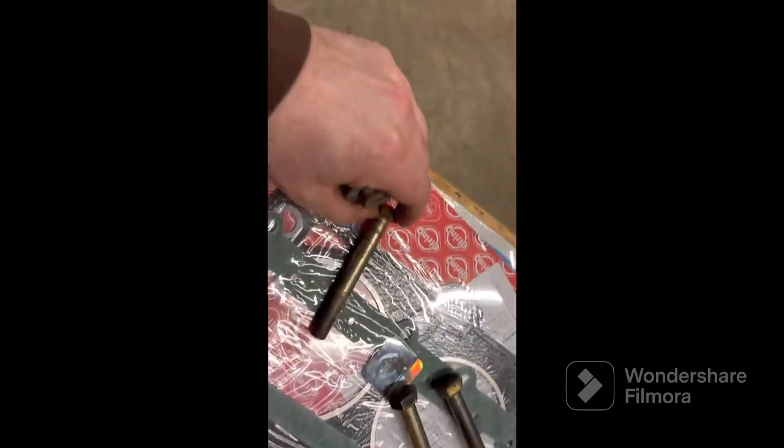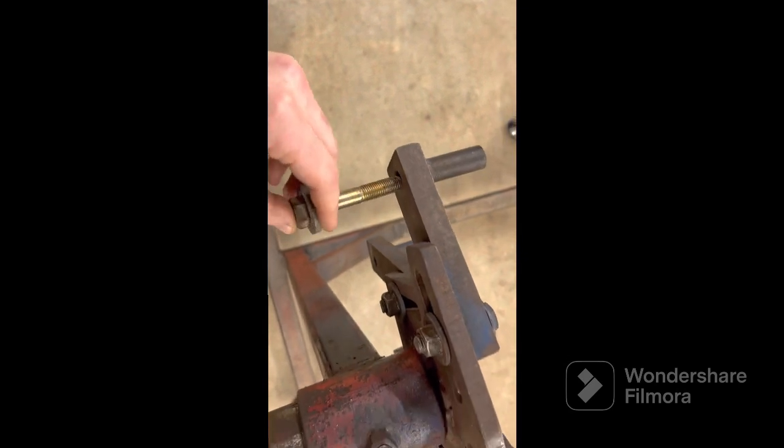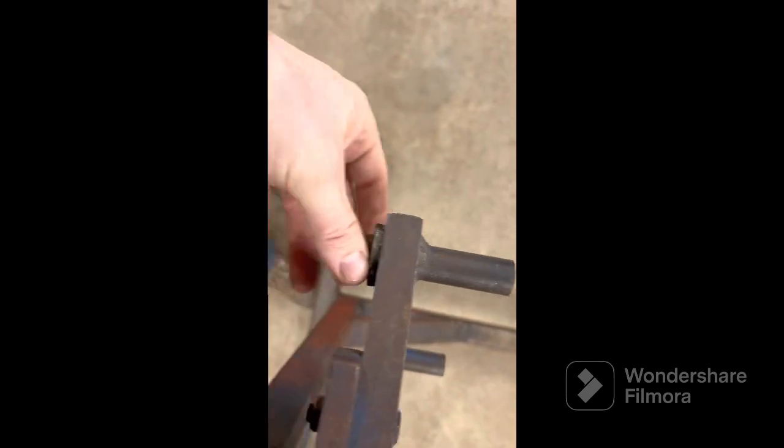So I pulled a subframe bolt out, and just comparing it, this short bolt right here is as short as I can go. This one looks a little bit too short, so let's just put it in the stand. No! But while I was under there, I was looking around for other bolts that could be stolen. A control arm bolt, one of the front mounts for the control arm, looks like a 12 millimeter, and it is a little bit longer than this one, so I think I can use that. So I'm gonna take one of those out real quick and give that a try.